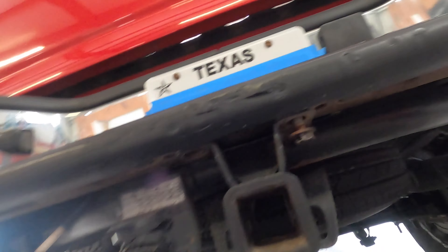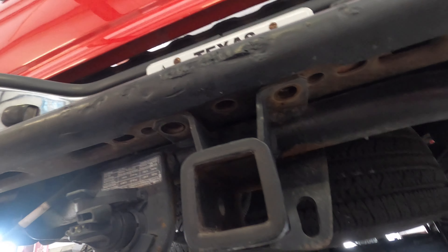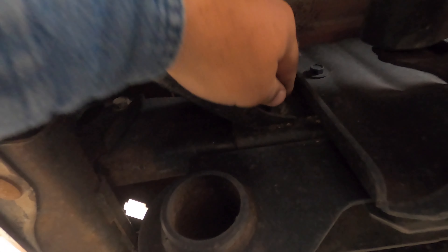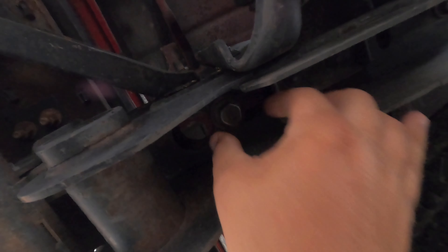You're going to have a receiver hitch with two bolts on each side — those need to come out. Around here you have a bracket with two bolts on this gusset plate. You don't have to hold the back up because on the other end they're held — these bolts will come all the way out straight across. There's one more on the opposite side and one more under the receiver hitch. After all those bolts are out, the bumper should slide right off.